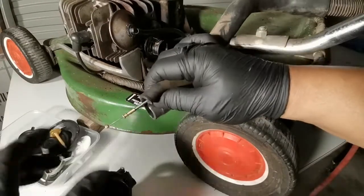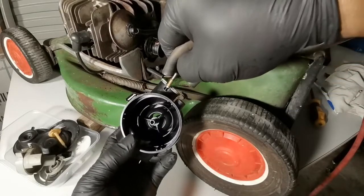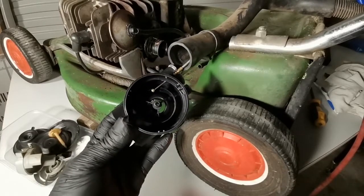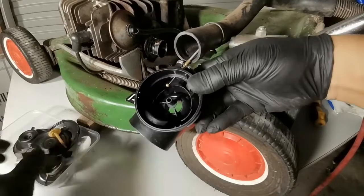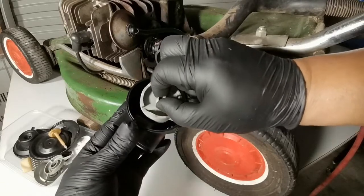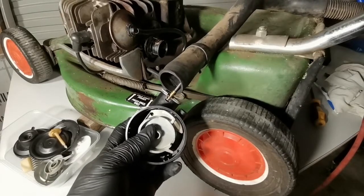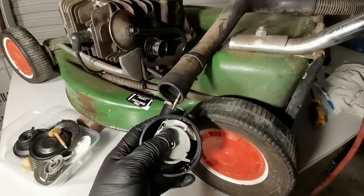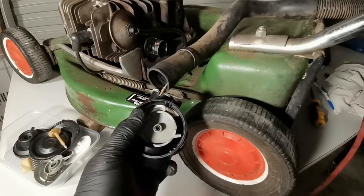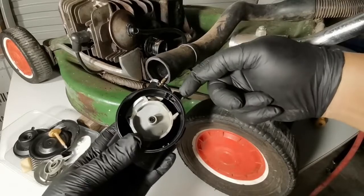Another way to install the carburetor is to install the throttle cable first. Insert the throttle cable like this and adjust the throttle — it's just right there. Place the cam where the holder is lining up with the bow tip of the throttle cable. Move the throttle and the cam, then rotate the cam so this part here is positioned towards the kill switch.